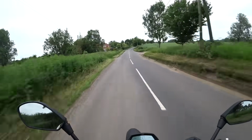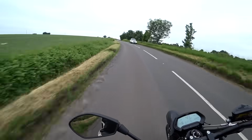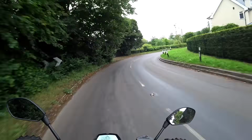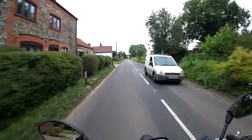And then when it comes to charging time, to get yourself another 60 to 70 miles, plugging straight into ordinary 240 mains, this bike is going to take about 7 hours to charge to full. Now, the charger for this bike is the thing hiding behind the front wheel that looks very sneakily like a radiator, which as standard is a 1 kilowatt charger.